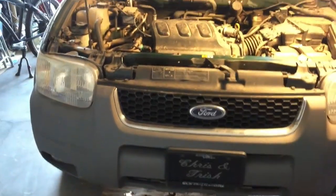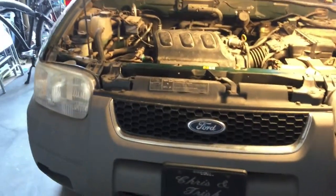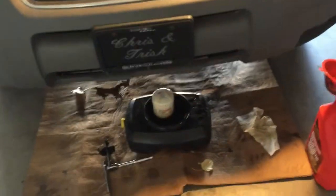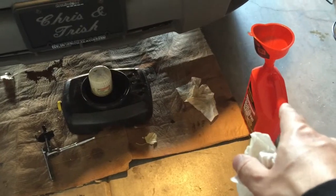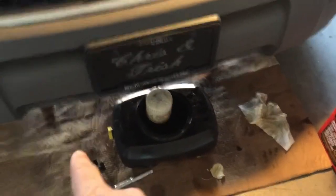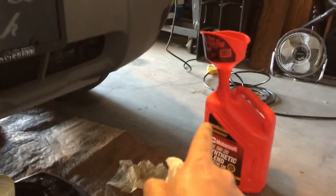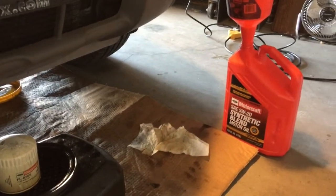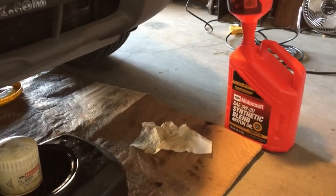We definitely need to add probably the rest of that five-quart jug, so I'm going to repeat the filling process. We are now done with the oil change — I got it to where the dipstick looked good enough, but it didn't quite show up on camera so you'll have to trust me on that. The next and final step is cleanup. You can't just pour oil down the drain or toss it in your dumpster. I use the five-quart jugs because this oil pan has a big lid that screws on top, then I'll pop that lid off, pour it in through my funnel, bottle it up, and take it to a mechanic shop. They'll usually make you sign something to keep track of how much each person's using, but then they'll recycle the oil responsibly.